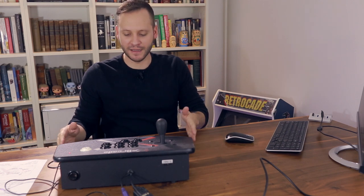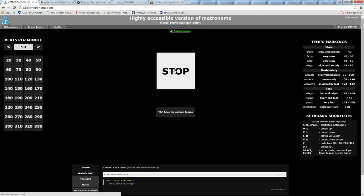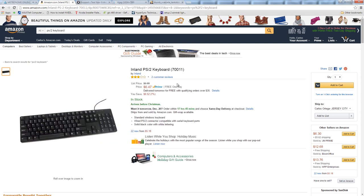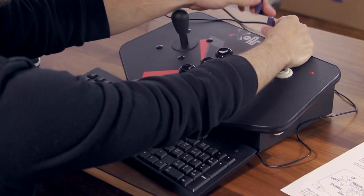The next thing you need — and the only requirement really aside from the actual X-Arcade stick and a computer — is one of these keyboard guys, and it has to be a PS2 keyboard. If you take a look at the end of the cable, it's a purple, round connection — the older connection before USB was around. If you go to Amazon and type in PS2 keyboard, you can find one for about $6.47, so it's really cheap. You cannot use a PS2 to USB adapter; it will not work. Once you have this keyboard, plug it into the purple connector in the back. Sometimes it'll be black, but it doesn't matter.